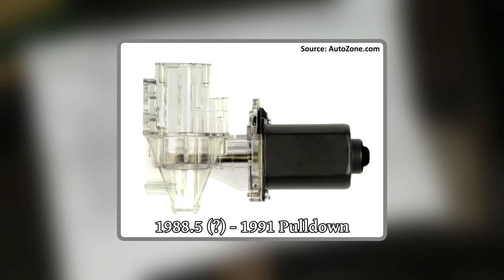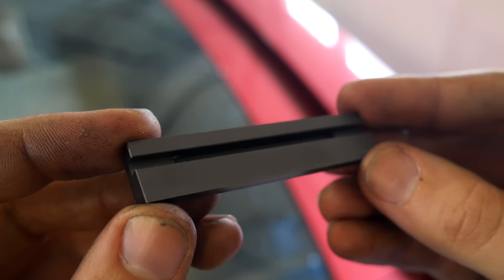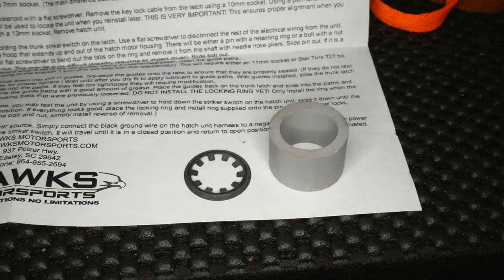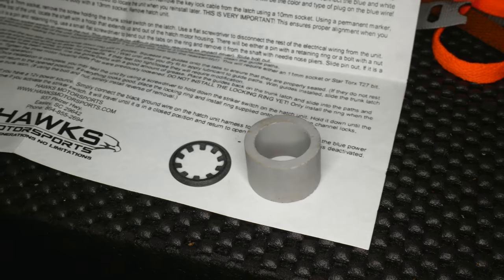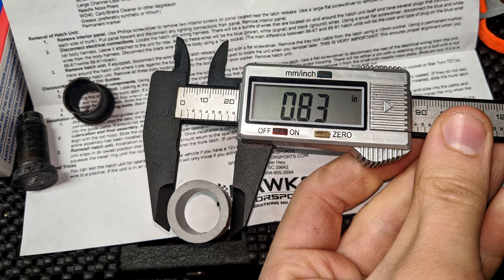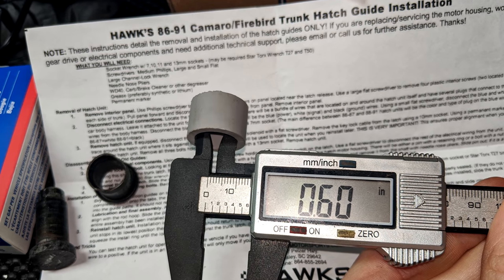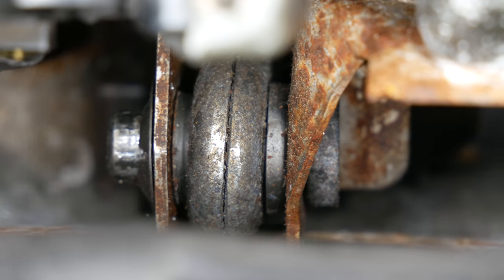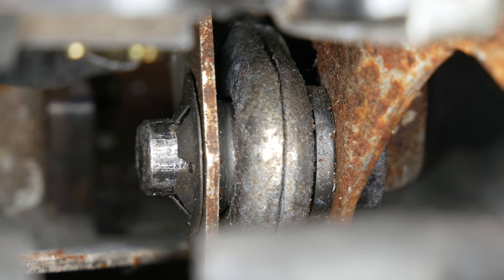To further complicate things, partway through 1991 they actually tweaked the design again. Luckily the design of these guides hasn't changed, but another part in the kit is a little piece of pipe and it doesn't seem to fit anything. I think that piece and the included lock washer are supposed to be for the pin that goes through the eyelet coming out of the motor gearbox. Unfortunately that means we can't use that part from the kit on our assembly, and it does seem like we have a bit of play there that would be good to address somewhere down the line.